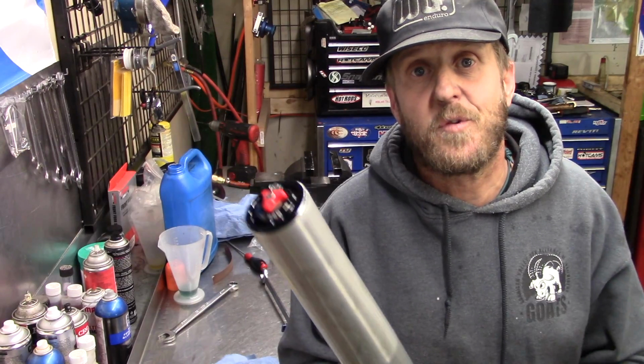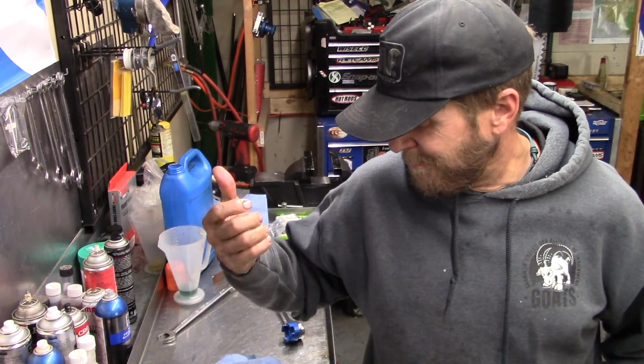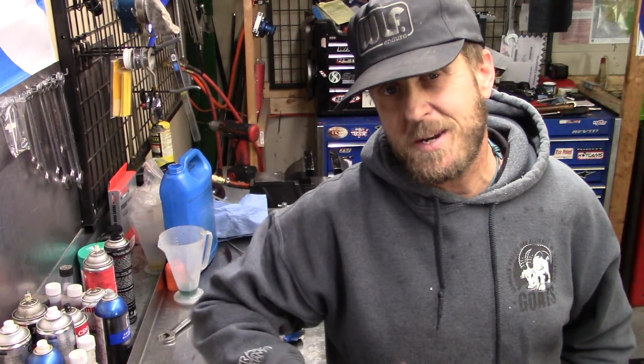Yeah. Hope you guys get your fork seals done. Keep those things in good shape. Even if they're not leaking, every 40 to 50 hours you ought to be servicing the forks.